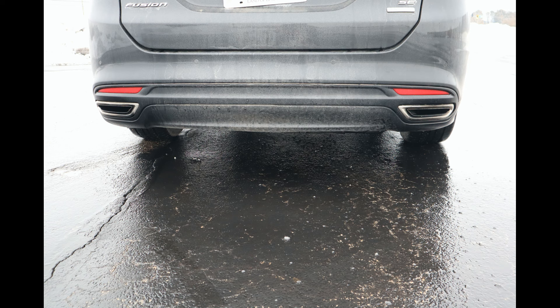Since there's more fuel and less air when combustion takes place, there is going to be unburnt fuel that ends up going to the catalytic converter, which comes out of the tailpipe — and that's what turns it into black smoke.